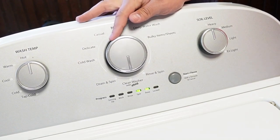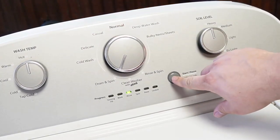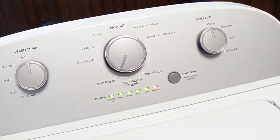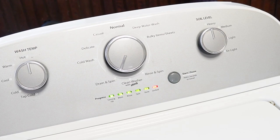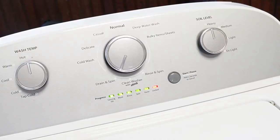Once you're in this mode, turn the knob clockwise four times. The rinse light should be the only one illuminated solidly by itself — this is the recalibration mode. Once you press the start button here on the rinse mode, the door lid will lock and it will begin a series of tests and operations on your washing machine. All these tests take approximately three minutes to run all the way through. As the recalibration mode runs, every part and process on this washing machine is going to be run and the machine will physically reset all the components to a default state, allowing them to run at an optimal level. During this time you're going to hear all kinds of noises from the machine and that's going to be totally normal.